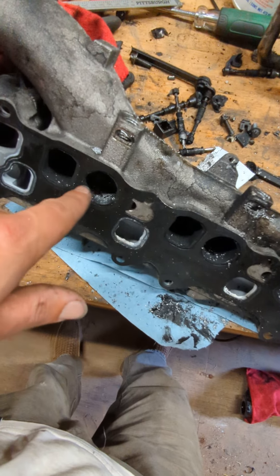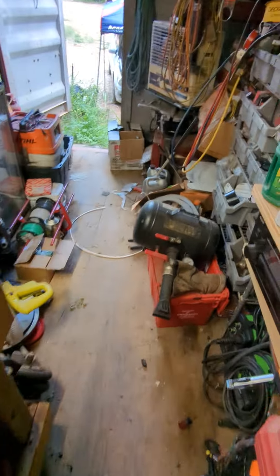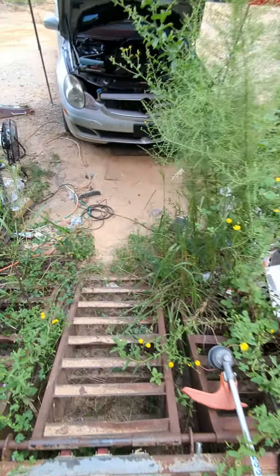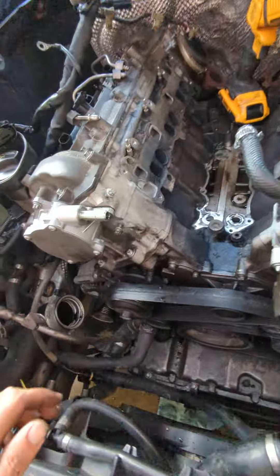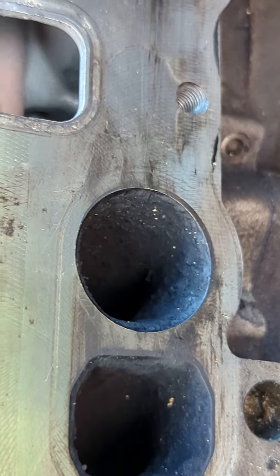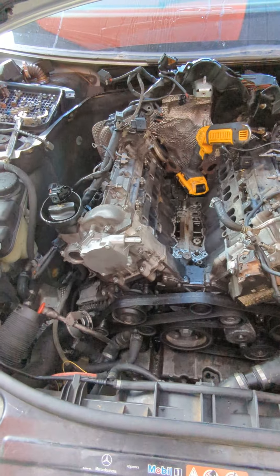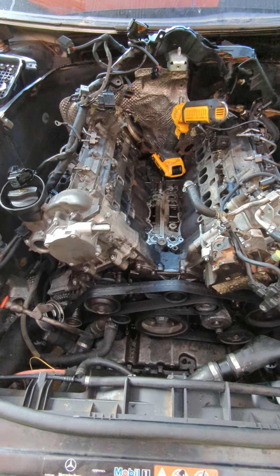Of course, blow all your swarf and stuff out of there. I'm probably going to get the pressure washer with a little swirl tip on it and clean all this out. I'm not going to clean the heads — you can, but you've got to pull valve covers and check the lobes, make sure it's not on the valve. Let's be honest, I'm not getting in there. For a daily driver that's going to make standard horsepower, it can be dirty — it's made it this far in life.